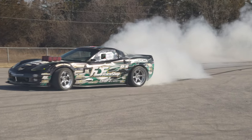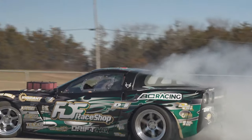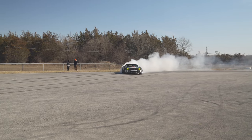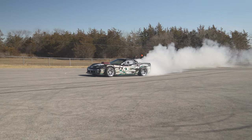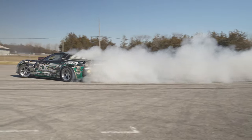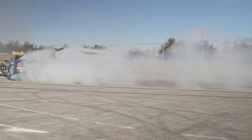The reason you might have a soft bar is to get the best of both worlds. I personally run between a soft and a medium rear bar, and this is going to give you the best of both. In cases of smaller tracks and medium tracks, we're able to maintain good traction, good contact, and still have good side grip and forward grip while using a soft to medium bar.